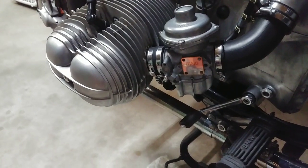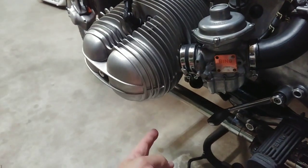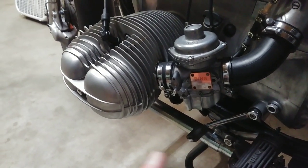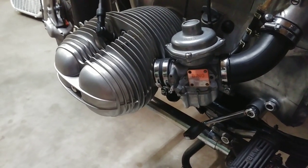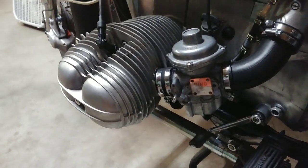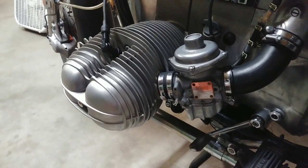Then it looked like it was actually a push rod tube seal under the cylinder here, and I know those seals are all relatively new so it's not old hard rubber. I jiggled the seal a little bit in this location, pushed it a bit, and it seems to be holding oil without leaking.